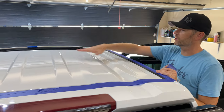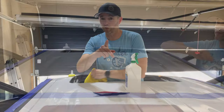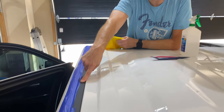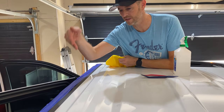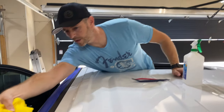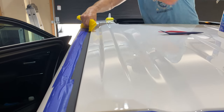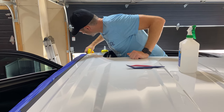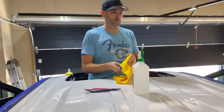Now we'll use some isopropyl alcohol to clean the area. I'll put a little bit of tape just around the edge of that shark fin. I could pop the drip rails out, but I don't want to break any clips — there's enough space that I'm confident I can tuck the film in. To make sure it sticks, you do want to clean in behind the weather stripping on all of these areas. I've already done the windshield — there's a rubber flap there you can lift and clean behind. Look at the grime that comes out of there.